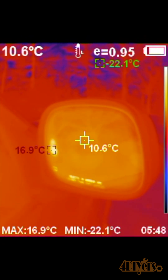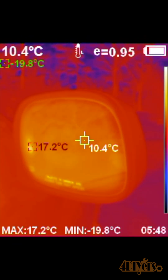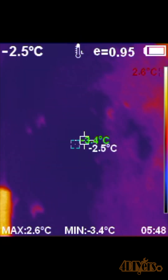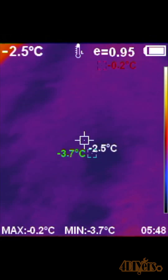Going back, I am seeing some warmer spots in the mirror. I'm seeing values anywhere from 5.7 degrees Celsius or 42 degrees Fahrenheit to 18.6 degrees Celsius or 65 degrees Fahrenheit. This does show the heated element on the mirrors is working. However, the driver's side is showing a lesser value, so it's most likely failing much quicker than the passenger side.